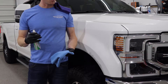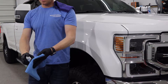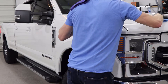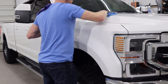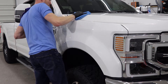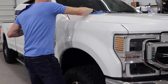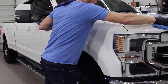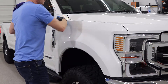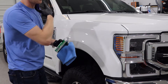I'm going to do the hood here — you won't be able to see it that great, but when I get down to this panel you can get a better look. With this coating I do just a couple sprays and then wipe it on in a circular pattern to cover the whole area you're working. One thing a lot of people notice especially on a white vehicle is it's really hard to see it going on, so you kind of just have to trust that you have enough coating on your cloth, because you will not see it go on. Wipe in a circular fashion and then back and forth — just double coverage, go over everything twice.